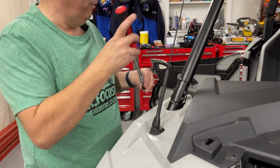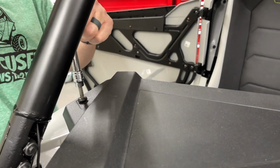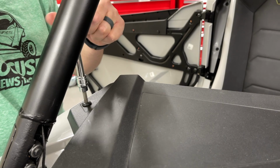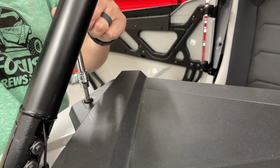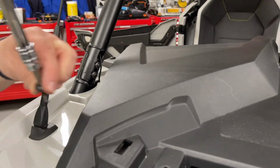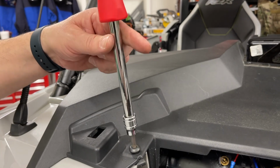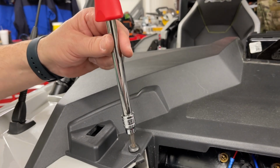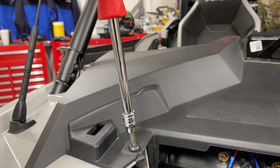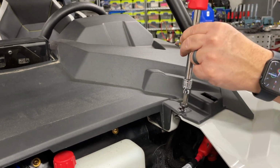Now we're going to put the Torx 40s on by hand. Again, not by machine. It will torque them too hard, and they will pop. Yeah, even a ratchet. I mean, it's like, you want like just, there you go. You can feel it. You don't have to get those things tight. And there's how many? 4 or 5? There's 4. So you can feel that. You don't have to go too tight on these because that little metal is fragile.